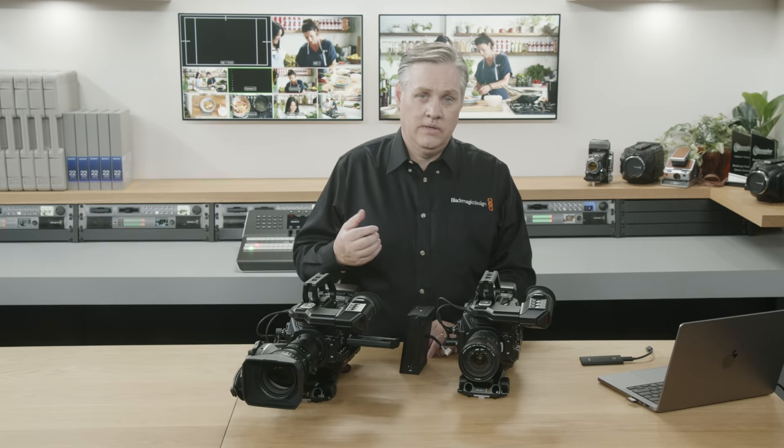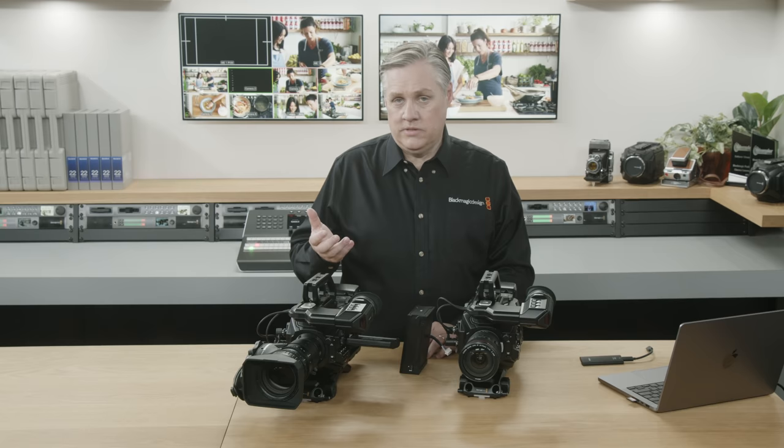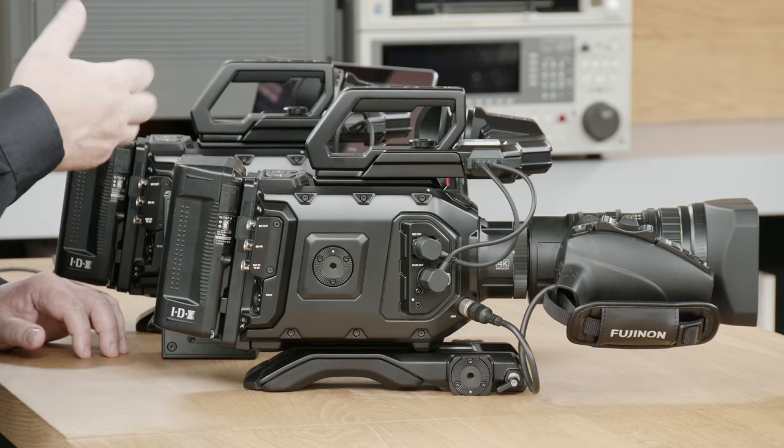There are so many different types of media this new camera can use: SSDs, U.2 disks, CFast 2.0 cards, SD cards, UHS-II cards (a faster version of SD), and USB external disks. Combined with Blackmagic RAW, ProRes, H.264, and H.265, you get the best range of codec formats available — which is really why it's three cameras in one. You could shoot a commercial in Blackmagic RAW and then shoot a news story in H.265, all in Ultra HD, so your media is future-proof.